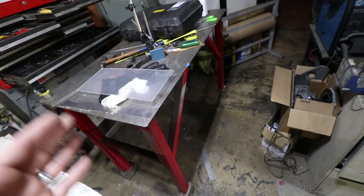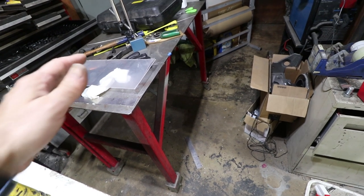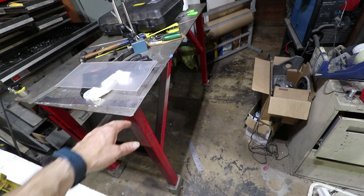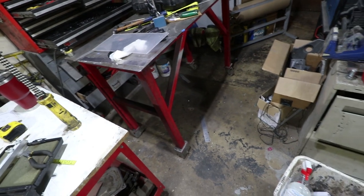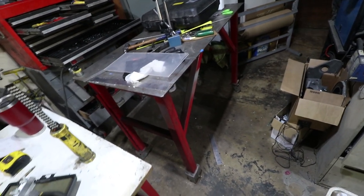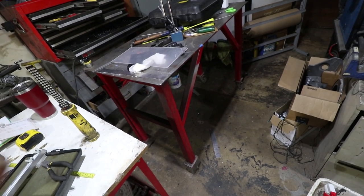And that's kind of similar to my car. The distances are just out of whack. And so more of the weight is being carried by one of the tires than the other. And the idea of corner balancing is just kind of like at a restaurant, you put something underneath the table to make that leg longer. Well, we're gonna be doing that with the torsion bars. We're gonna adjust the torsion bars to make one of the legs longer.